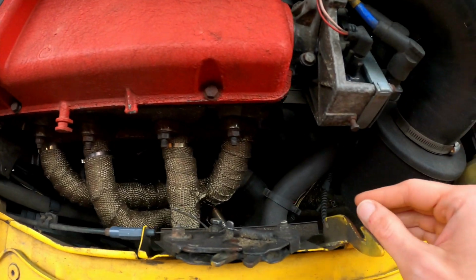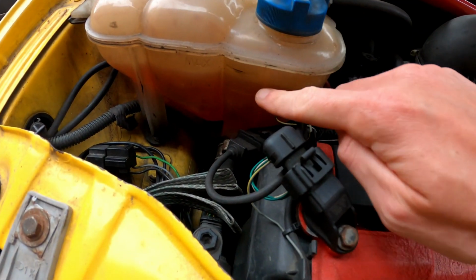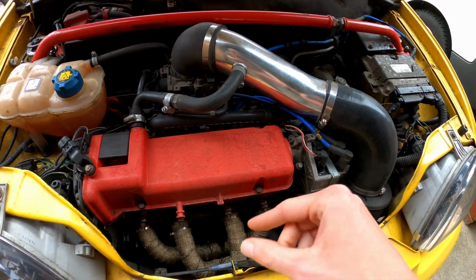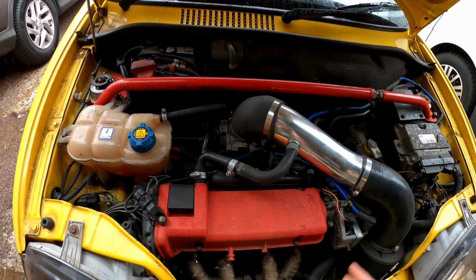No issues of any leaks anywhere. There's obviously nothing wet, nothing damp, nothing leaves any puddles, hasn't lost any coolant. We're up on an angle here, but it's never losing any coolant. We're going to change the thermostat as well, because that's another common failure point on these engines. It might be sticking slightly, not enough to overheat it, but potentially enough that it's causing higher running temperatures.